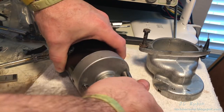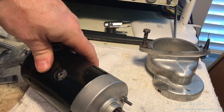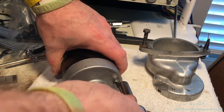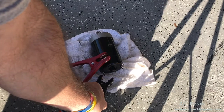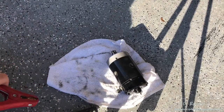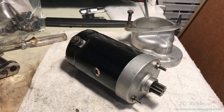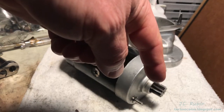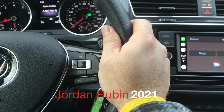The way that armature is bent, maybe I'd get a hundred starts out of it. Chances are the first time I run this thing it's going to eat that brass bushing in the back — that's probably exactly why it looked the way it did when I opened it, and I didn't initially catch the bend either way. Let's try it out — yeah, the rebuild works and it sounds nice, but it's going to vibrate itself to pieces. If I put it in the bike I'd probably end up taking it out within a year, so sadly I'm going to replace it. Still a fun rebuild. That concludes the rebuild of this Hitachi starter for a Shovelhead engine. Hit that like button and subscribe for more videos.